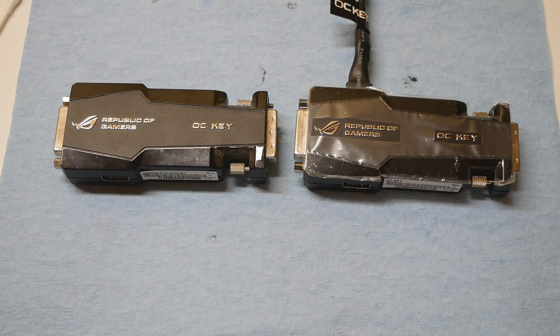The topic of this video is about that whole thing — why I couldn't use the OC Key. As the OC Key originally came with two different motherboards, the hard thing is that you cannot actually upgrade the firmware of the Rampage 4 Xtreme OC Key to the Maximus 5 Xtreme OC Key. Even though upgrading the firmware is heavily advertised in the user guide booklet and on the ASUS ROG website, you cannot find the correct firmware for the Maximus 5 Xtreme at all.